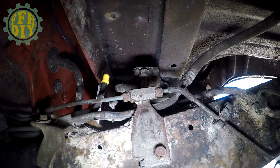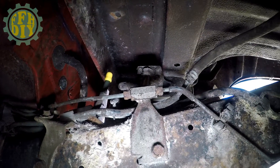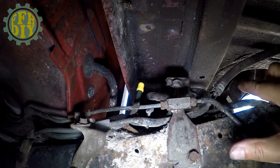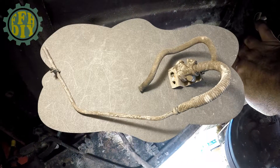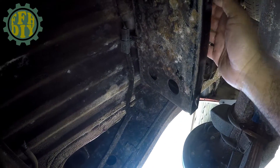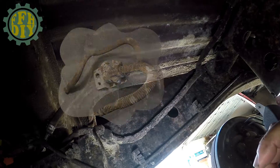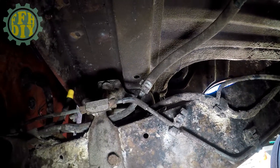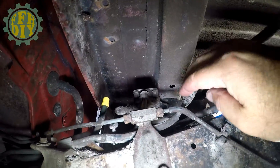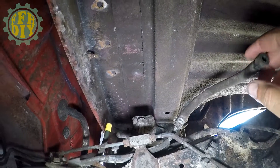While I don't have the tank in, I wanted to show this real quick before I start assembling everything. Here is your fuel line going forward — this line crosses over to another line which has already been removed because I got rid of all the lines that were attaching to the original fuel pump — the filter and the check valve, I think, to keep fuel from flowing out when you flip over. I got rid of all that. Here goes your electrical connector and this is your fuel return line. These are the two main lines that you need for this mod to convert it over to just a normal fuel pickup setup.